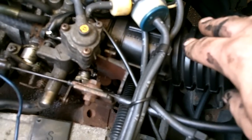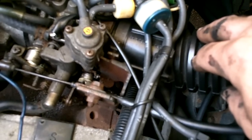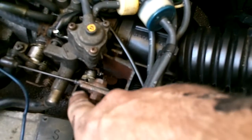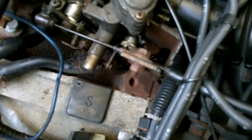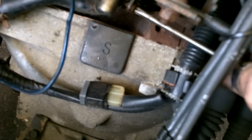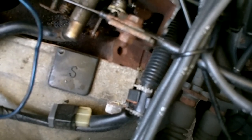If you were actually going to adjust a cold carburetor, the first thing to do is remove your air intake. You can see the position the choke is at - the choke is not closed. When you turn the key on, don't try to start the truck; just turn the key on and see where the choke is. Start off by lubing it up and making sure it's all free and the choke is opening up. To close the choke a little, you will actually tighten this Phillips head screw. Once that's done, start the truck.